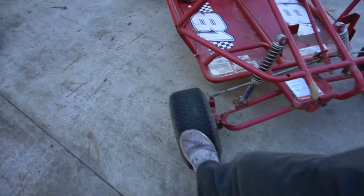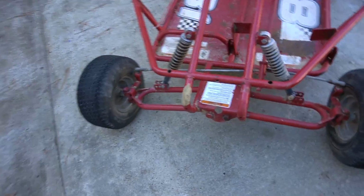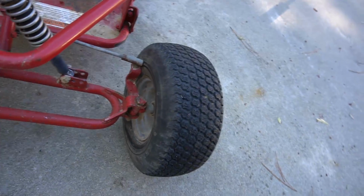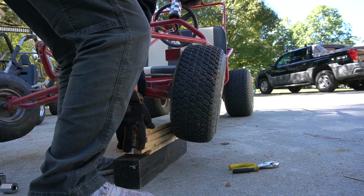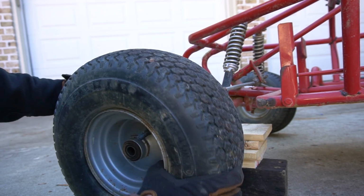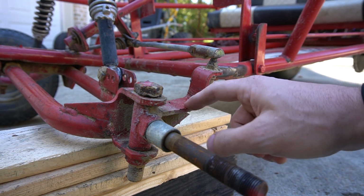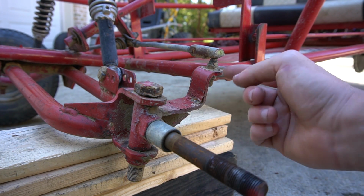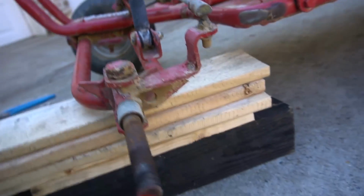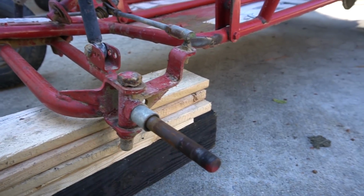So it also looks like, yeah, we need some air. So should be a quick adjustment of the tie rods. Need to bend this back into place too. We're gonna lose our tire if that keeps up. So here's our problem. It's the part of the spindle that branches off and attaches to the tie rod. At the same time, this thing was not designed for what we put it through. Was not designed for a Subaru bigger engine either.